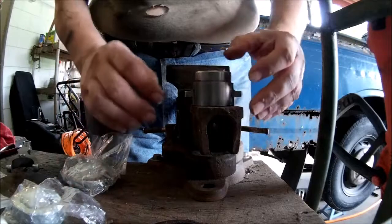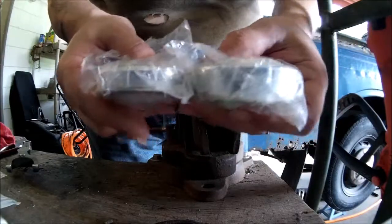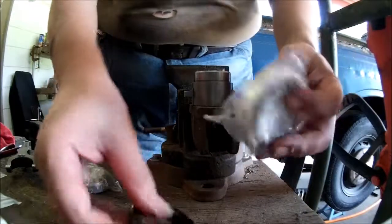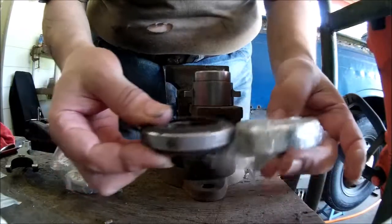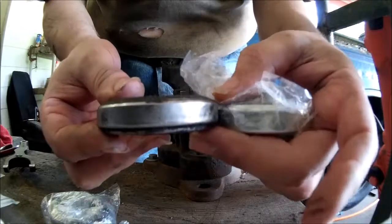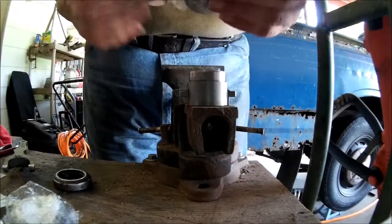And here's one of those times I gotta show you. This clutch kit came with two different throwout bearings. As you can see, the thickness is different. If you use the wrong one, you could get messed up. So this is the time you compare your old part to your new part. And we have a winner. It's the thin one, not the thick one. The thick one's probably for the 22R, I'm guessing.